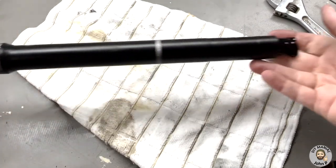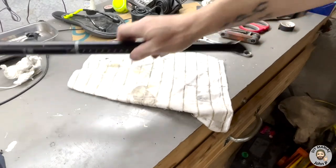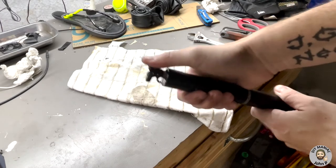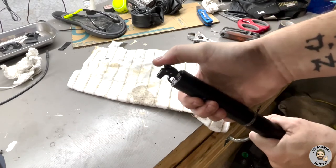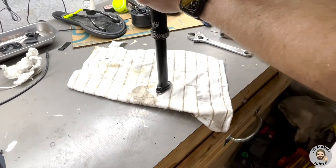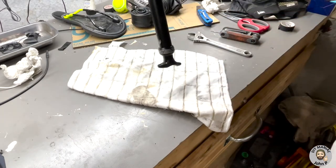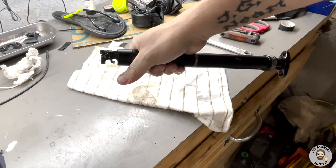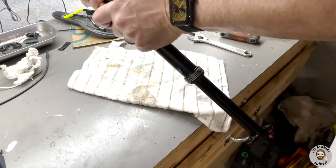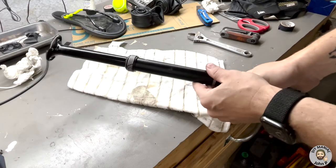We are now fully assembled. If you like to bench test to make sure you did everything right, take your thumb on the actuator to mimic the cable being in place. Pull back on the actuator, put the post on the workbench, keep it straight, and push down to mimic retracting it. Make sure it holds in place, then release the thumb and pull back again — it pops right back out. That confirms we have a fully operating dropper.